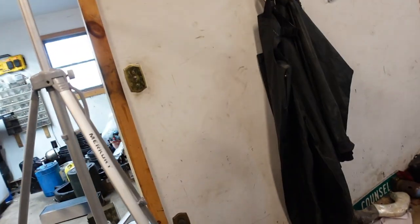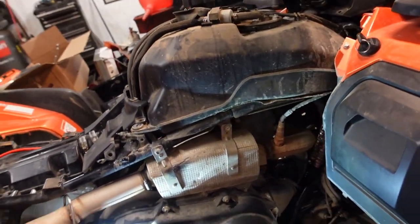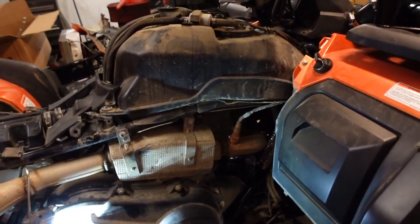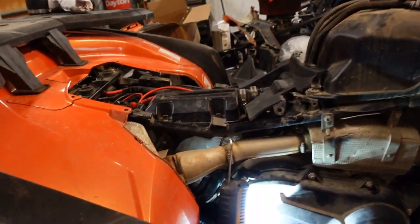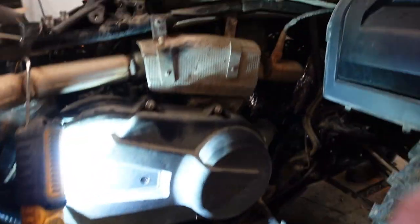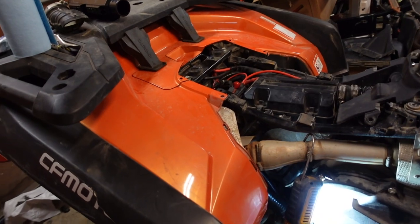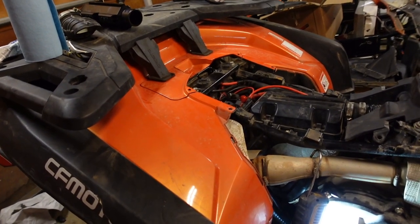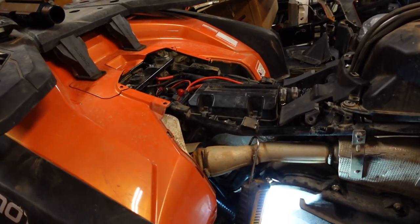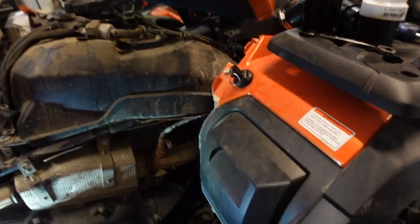Oh, that was the one thing I did want to talk to you guys about. Putting this flexible PVC pipe in. First attempt, I tried to bring it from the front. Don't do that. Take the rear tire off, feed it in right through here and down. It's a much easier feed. So start in the back, right through, and heat tape it before you actually push it through, because how are you going to dry fit that? So, all right, we're going to go to the next step.